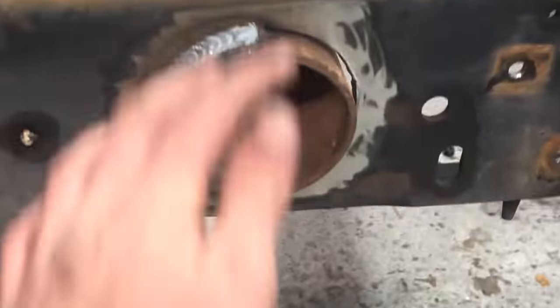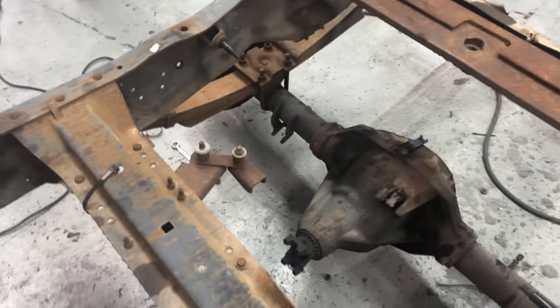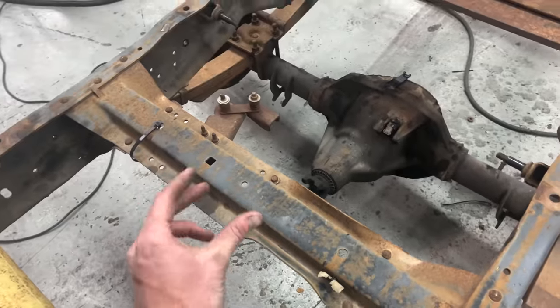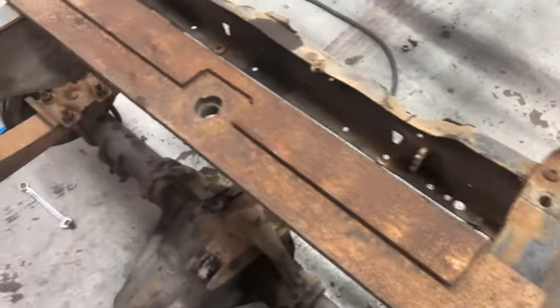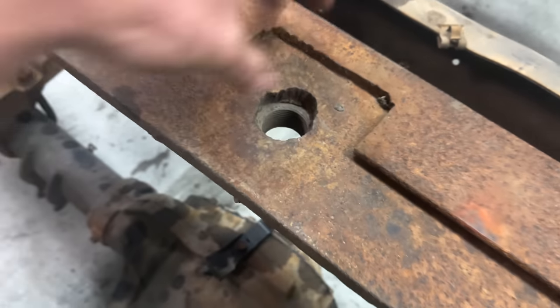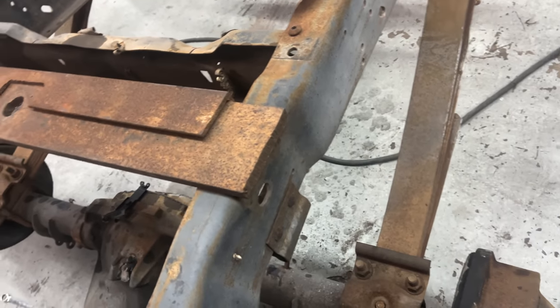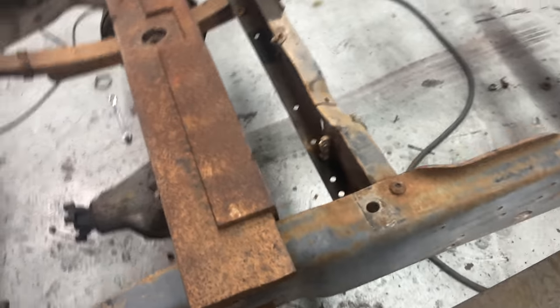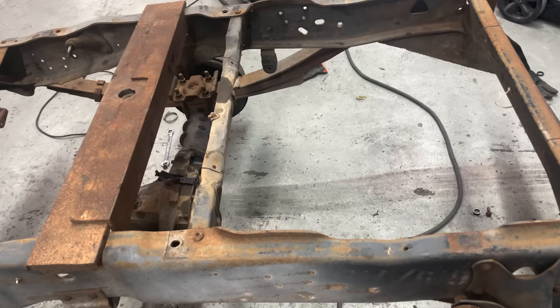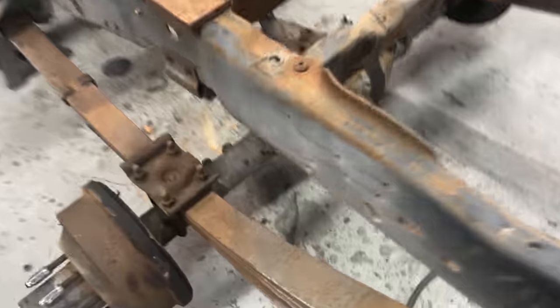Now that that tube is welded on the half to the main frame, I can go through and chop down all my cross members. I already have my lines marked. So I'll chop there, bring the cross member together, and butt weld it. Here's a homemade gooseneck hitch that was put on this truck before me. Literally just a welded nut down in there that you thread your ball into, but it's not super strong. It's hardly welded to the frame, so we're just gonna hack it off and get rid of it, so it won't be in the system anymore. So chop there, chop there. Chop there.